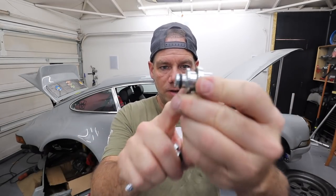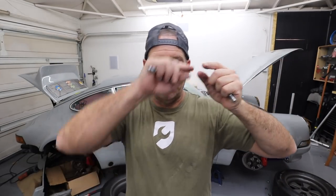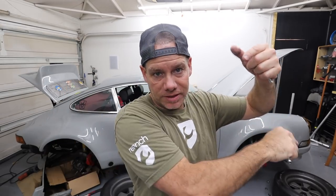So the inner part here is exactly the same no matter what hose. So what you do is you go out, you go into the first condenser, out of the first condenser, into the second condenser, out of the second condenser, back to the front of the car. And you go basically big, small, small, small. So that's what I'm gonna do. I'm gonna plumb this thing up the way he suggested.